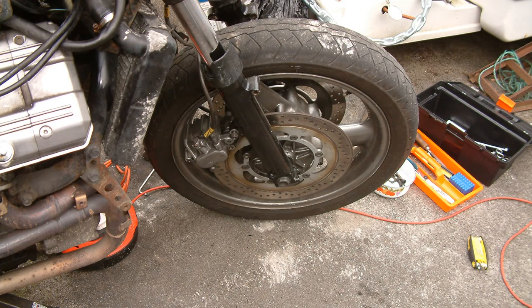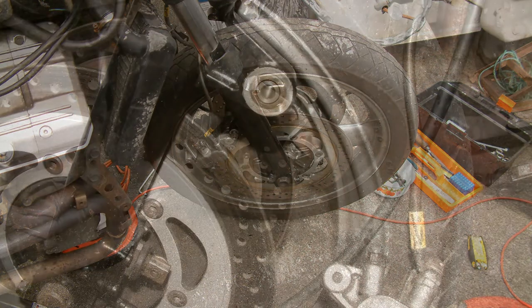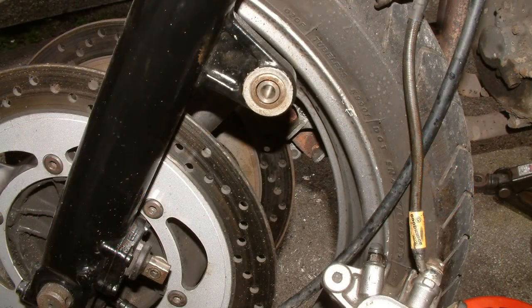Two things to look at here: first, the radiator — you can see the paint coming off; not going to do the aluminium with good. But look at the disc — can you see the brown? It had been overheating and warped the disc, so it was shaped like a dinner plate. Fortunately I managed to get a new disc from my local breakers.